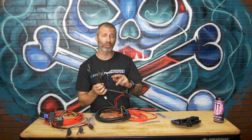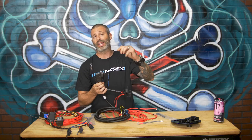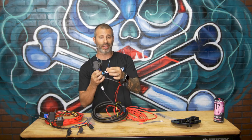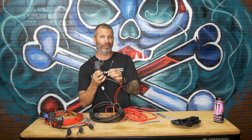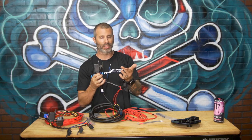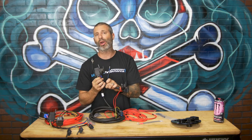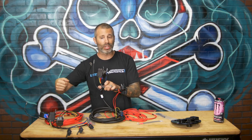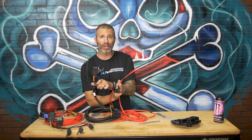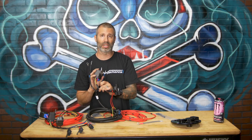You're going to actually cut that wire a few inches from the fuel pump driver module. The wire that's leading back to the PCM — not still hanging off the fuel pump driver module — you're going to connect to these blue wires right here. Put a heat shrink over it, crimp it, seal it up. That's it. When you key the car on in the on position, power will flow from your power distribution box through the relays to your pumps. It's that simple.